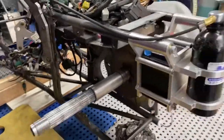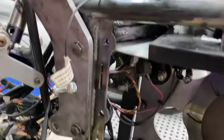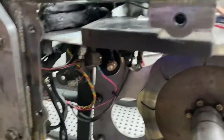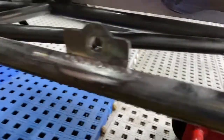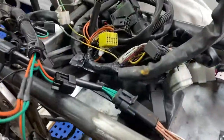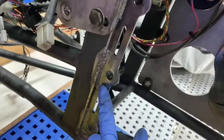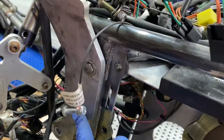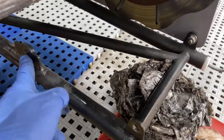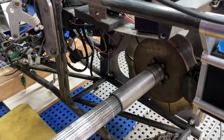As you can see, got all the axle apart on this side where the work was done. We've got a nice new bracket down there replacing what was broken, and we've also had an additional bracket here and an additional bracket there put in for added strength. The idea would be to basically paint the exposed sections that have been welded — we'll have to take off this plate here as well to get around the back of it, and basically just get the primer on, get the color on, got some clear coat, and see how far we get.